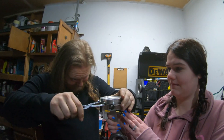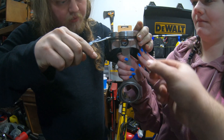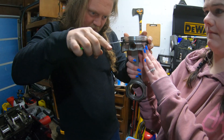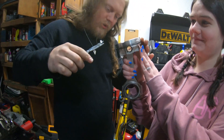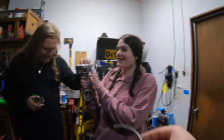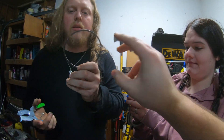This is the process - just lining up the rings and going up a bit higher. We're also using the worst tool for this - we used the nice one in a previous video. There are dots that tell you which way the ring goes for the second ring; the top one doesn't matter.